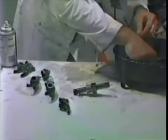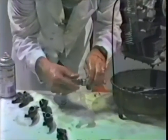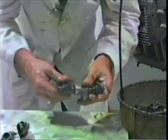You get out 2 shims, 2 springs, clean them off. The right arrangement is washer, spring, washer. Get out another spring. There's a washer already on there. So it goes washer, spring, washer, and the intake rocker. But before that, we put a little dab of our secret sauce on both sides. Take the intake rocker, stick it over, make sure it spins freely. If it doesn't, try the other rocker stand. Like so. Maybe tight getting on, but once it's on, it should spin freely.